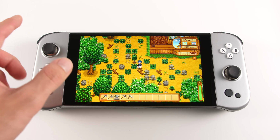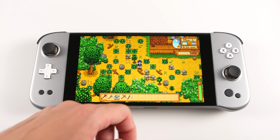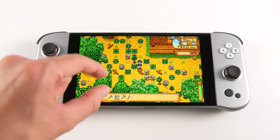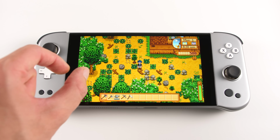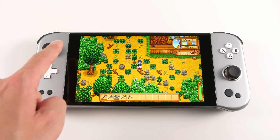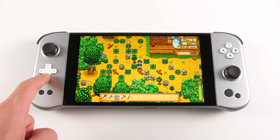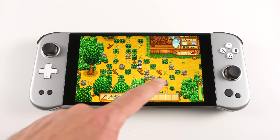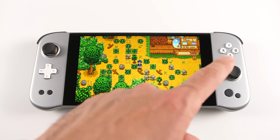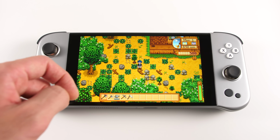The first thing that you'll notice is our 7-inch IPS panel. It's advertised as 500 nits on their website. It has smallish bezels on the top and the bottom, with slightly larger bezels on the left and the right side, just like the original device. We have a set of new analog sticks this time around that we'll look at more in just a moment. This device uses a white conductive rubber D-pad, and the bottom buttons have been cut down to 2 sets of 2. The ABXY buttons also use conductive rubber this time around, and we have a new set of analog R2 and L2 buttons.